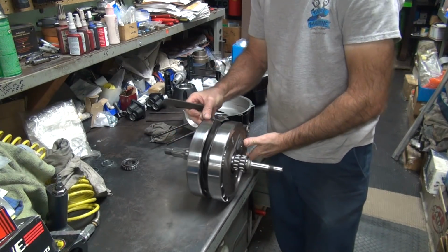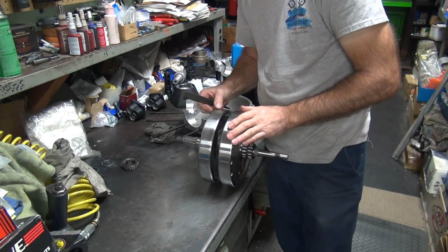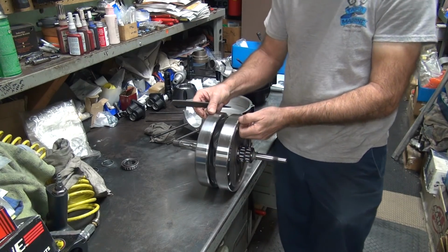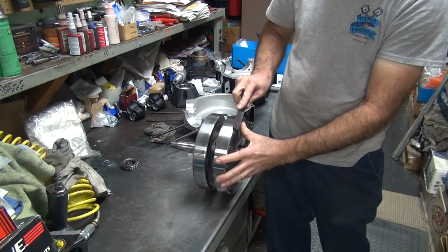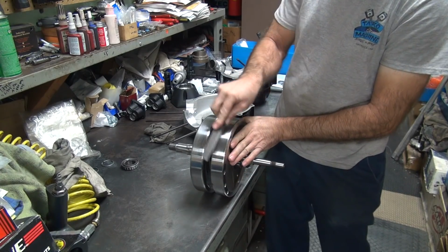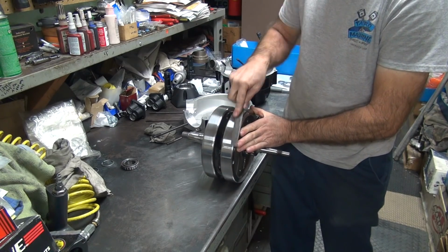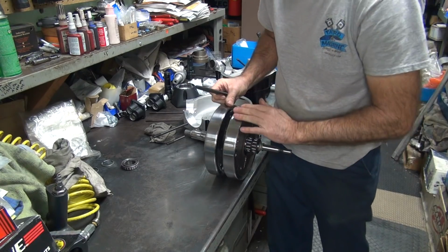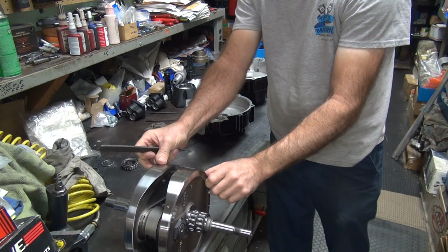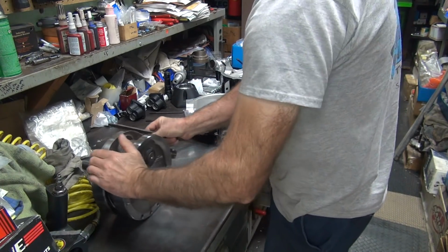So those are definitely sticking up in the air, those spots. See now when it goes across, it doesn't hit it like it was. You wouldn't think it'd be that much, but it is. Now here we got, see a sealer right here? Mm-hmm. Usually these little bang marks aren't enough to bother you, but for some reason these flywheels are really, really close to the case. Those marks are only sticking up about 15 or 20 thousandths, but you can see how it was hitting.